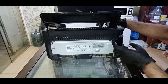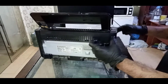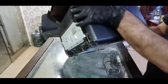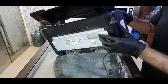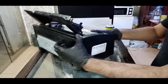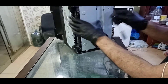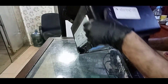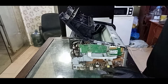These two screws I removed before. Now we will remove the right and left side covers. There are some locks — we have to be careful. One lock is here, one lock is here, and two locks are on the down side. With the help of these locks we will remove the side covers. The side cover is removed — in the same way we will fix the side covers back.